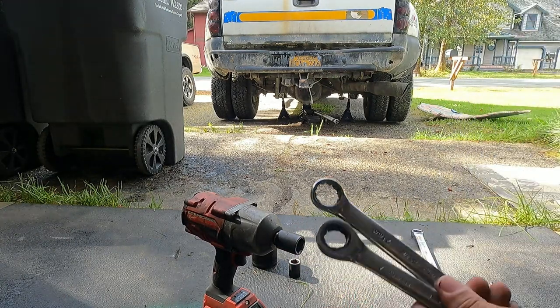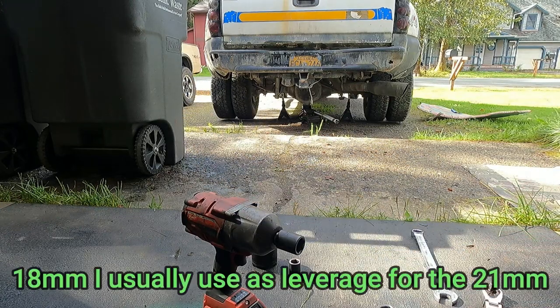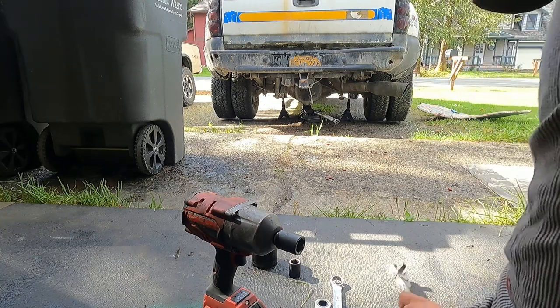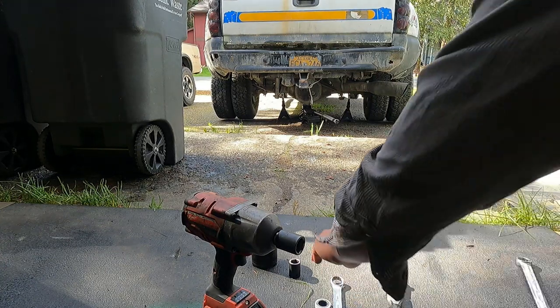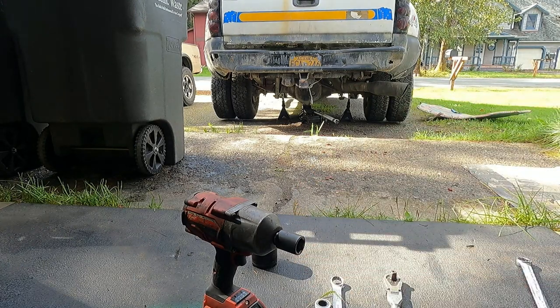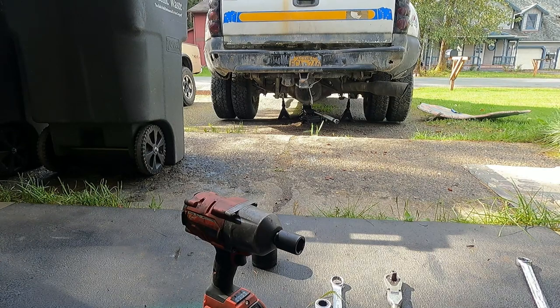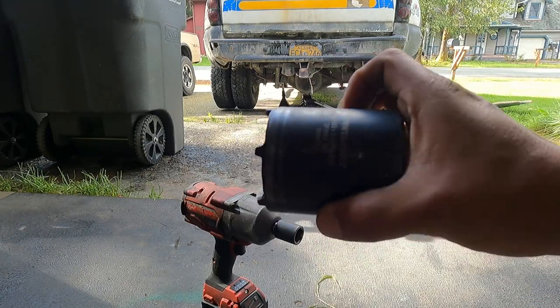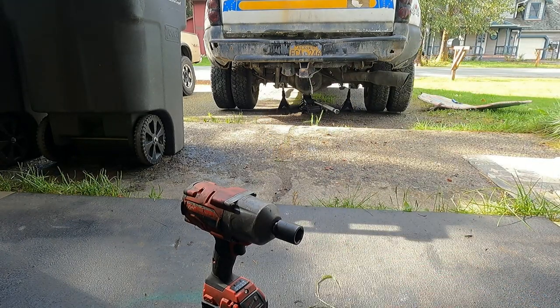We'll need an 18 and a 21 millimeter to remove the calipers, and I believe a 19 millimeter here to remove the axle. All right, let's start by removing those tires. Oh, and you'll need this spindle nut tool. I'll put a link in the description for all this stuff, but you'll need that to remove the spindle nut off of the hub there.